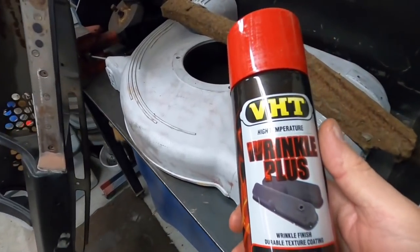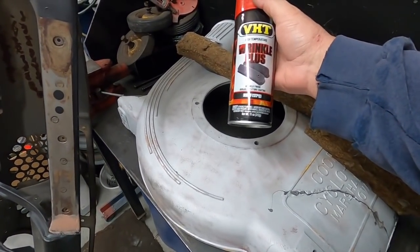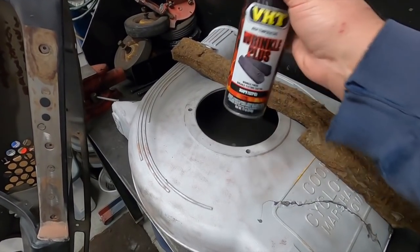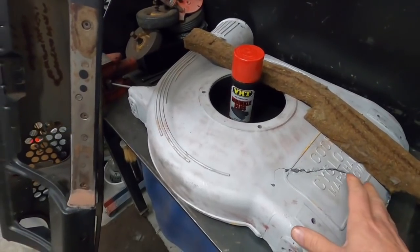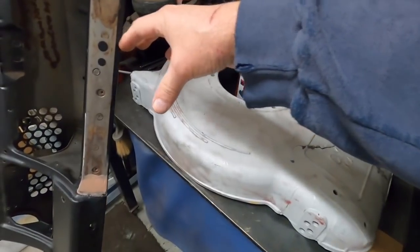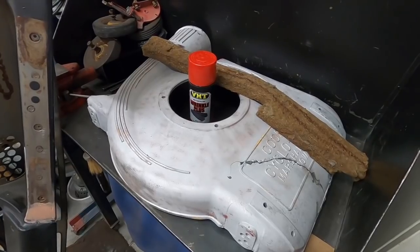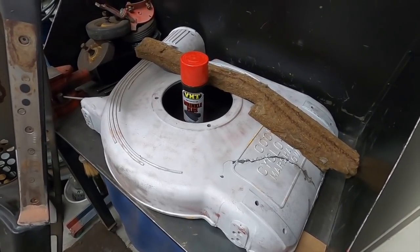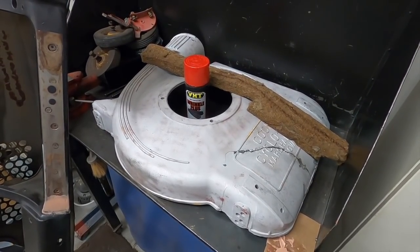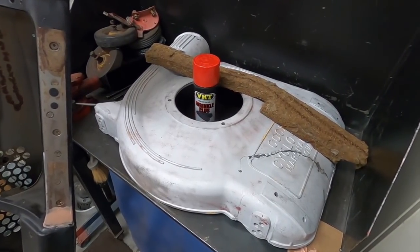This is wrinkle paint for the mower deck. I've used this stuff in the past and always used heat guns to wrinkle it, but I read the directions and it says to put five heavy coats on - one this way, one this way, one diagonally this way, one diagonally that way, and then one again this way - and as it dries it wrinkles. Then you can bake it in an oven at 200 degrees for so long, so maybe we'll see about baking it in the oven.